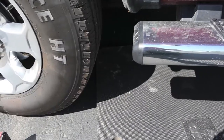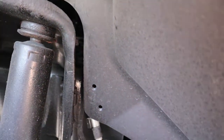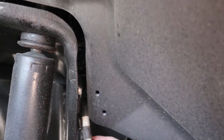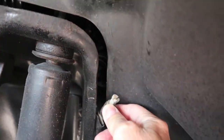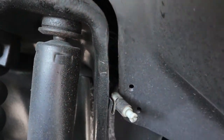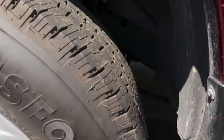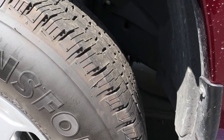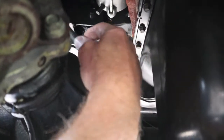We're back up front. I'll show you a close look at what the vent looks like. Keep in mind here's where it was — even being inverted would be a lot better. That was straight vertical, right where water could run straight down into it, right in this wheel well. You can imagine how much water is slinging up here driving through heavy rain and puddles. There's your vent right here. You just have to make sure you don't get it around the drivetrain.